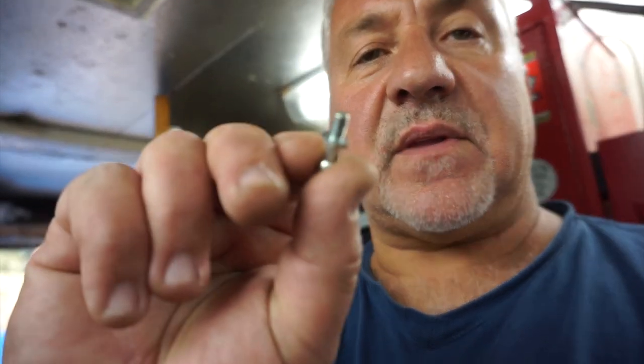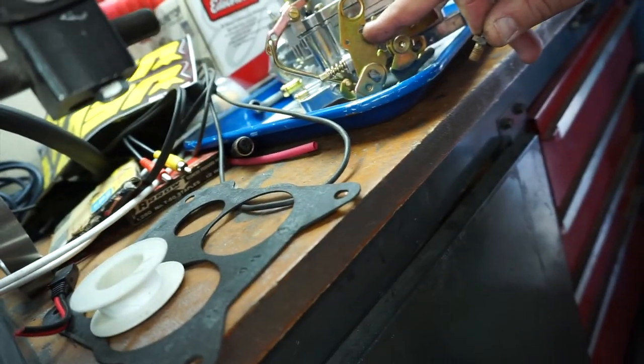So let's do it. Well, I ran into one little snag, and I went to change the bottle fit, the adapter, the original one. This is the one that they sent with it. It's the ball type, and this is the one that's on there, and it's the clip type, but I'm going to stay with the original. So I have to open the hole up to quarter inch. I measured it, so I'm just going to have to open this hole up a little bit with a drill. We should be on our way.